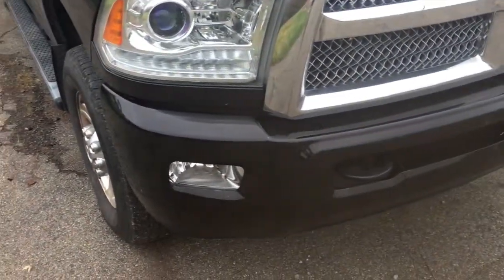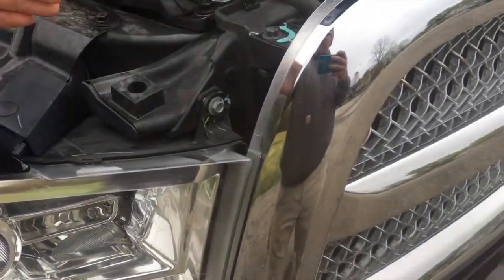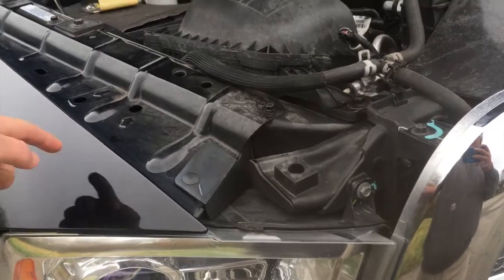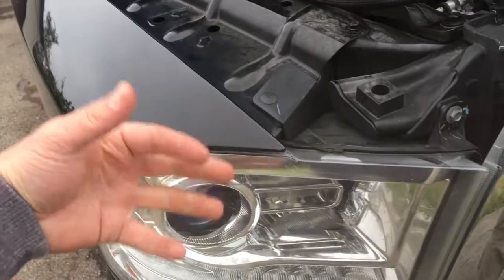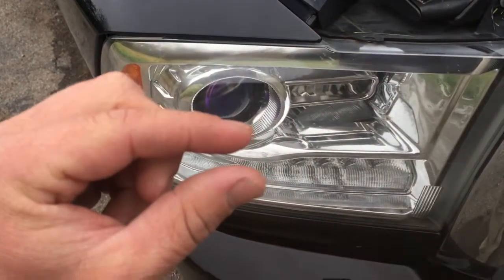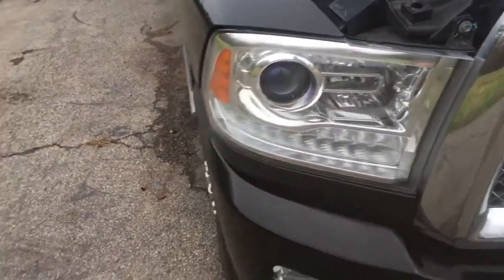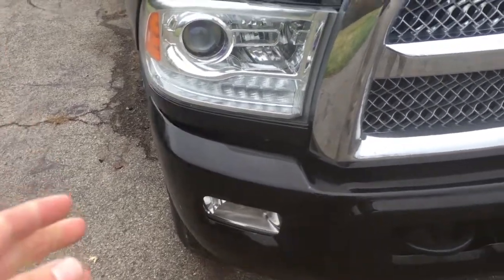It worked in my fog lights, but I couldn't get any of the headlights in because these projector lenses are completely 100% sealed in the back. There's 8 millimeter bolts that hold on the back of the light, so it's completely waterproofed. Between the bulb and that seal, there's literally that much room. And if you've ever seen an LED light, I'd show you, but it's down in my shop, they have huge cooling fins on the back and a harness, and it just doesn't work with this.